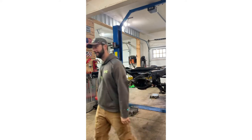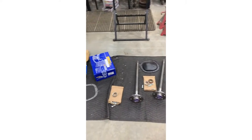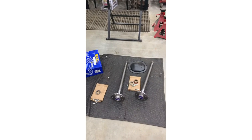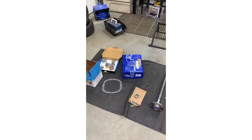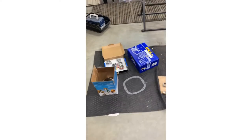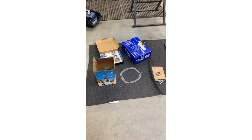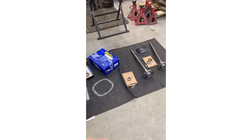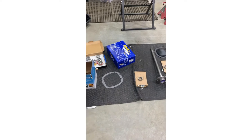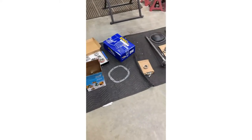Here are all our parts for this 10-bolt seven and a half inch rear end. This S10 came with 26 spline axles and a 3.42 gear setup, and it was an open end. We've got an Auburn Gear Pro Series limited slip we're putting in it, a complete rebuild kit with bearings and seals, new 28 spline axles - the bigger axles going in this truck - and a 3.73 ring gear set. This is a complete setup video.